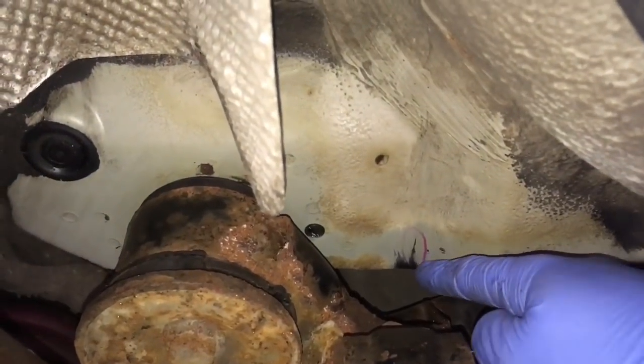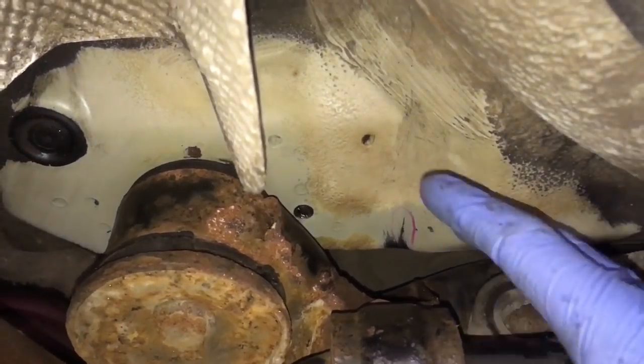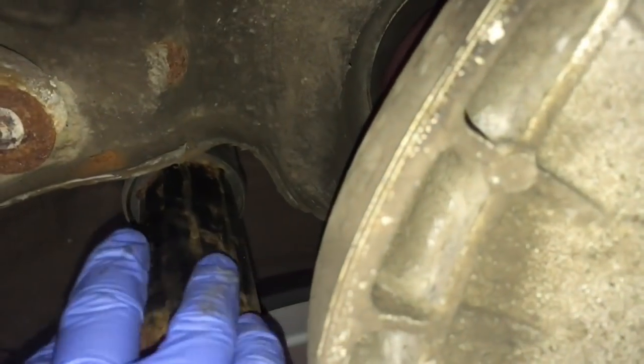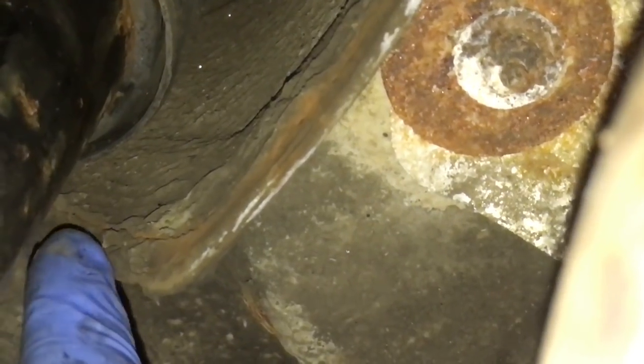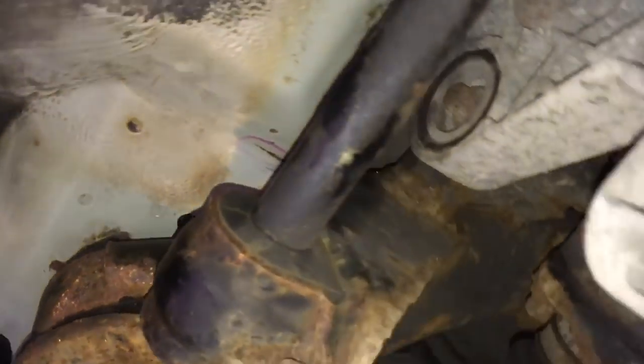It's not actually the first thing that happens but it is one of the most obvious things that an owner can spot. The actual first part of this issue starts on the internal section where spot welds break. We've got a spot weld broken, a bad one there, along with a corrosion line and a split down the seam sealer — showing the rear axle carrier panel has been moving only very slightly but enough to break some spot welds and then introduce hairline cracks as a secondary effect.